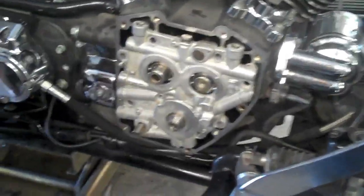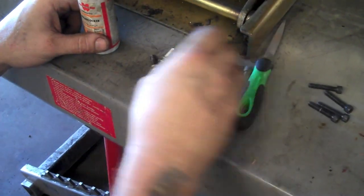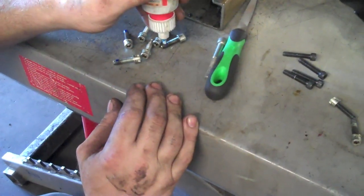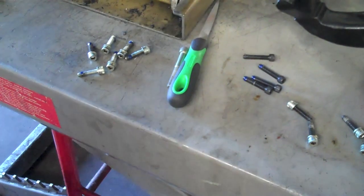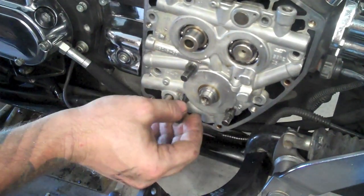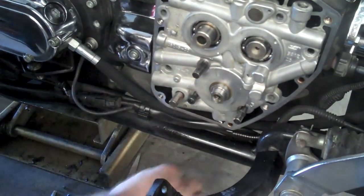We've got ten bolts going into this thing. Because of the new pump, we're going to replace four of these bolts with those longer ones. Set those aside and get everybody some Loctite — a little bit of blue on each one, not a whole lot, because it'll wind up everywhere except where you want it. These are the Evo tappet block alignment tools — just for alignment. I'm going to put these in here and get them ready. I'm not really going to tighten anything down on that oil pump quite yet.